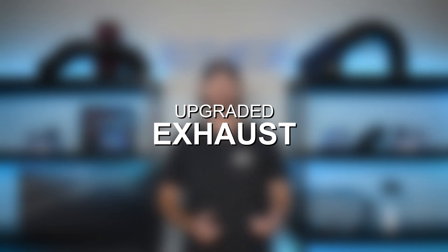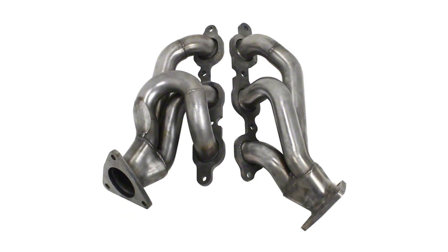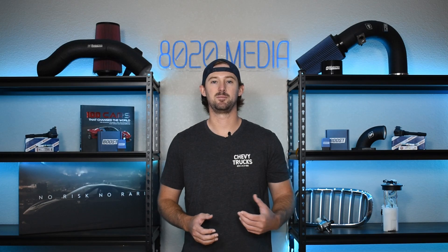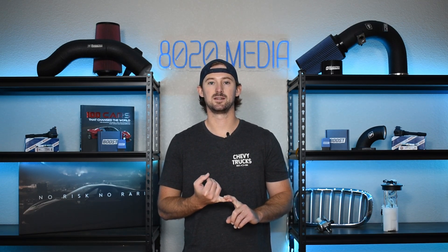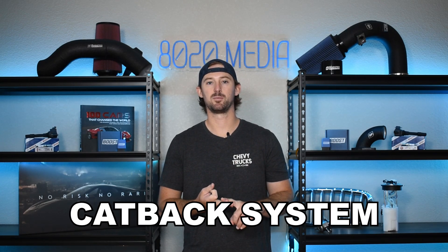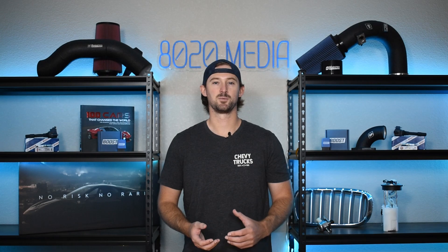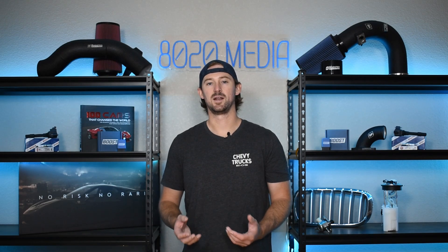The second thing is going to be upgrading the exhaust system. The headers are actually one of the most restrictive parts within the exhaust system on these 4.3 engines, so getting a good set of headers is going to offer some pretty good power gains and will be the best exhaust modification. Your best bet is upgrading the full exhaust system, which means either getting long tube headers — which will delete the catalytic converter — and then a cat-back, or if you want to keep your truck emissions compliant, shorty headers, a high flow catalytic converter, and a cat-back. Doing a full exhaust upgrade is where you'll see your biggest gains, likely about 10 to 15 wheel horsepower when combined with tuning.